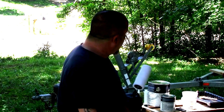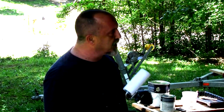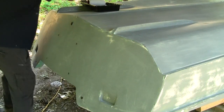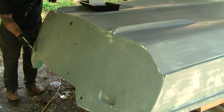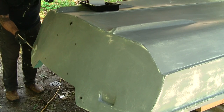I'm going to pour that out into the tray and get started. I'm going to start at the transom and work my way forward. There are some areas that have to be brushed just because I'm not going to get the roller in there. But this is going on nice and thick - you can see that already.